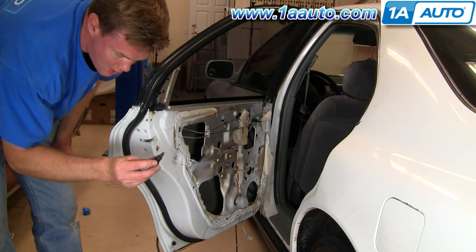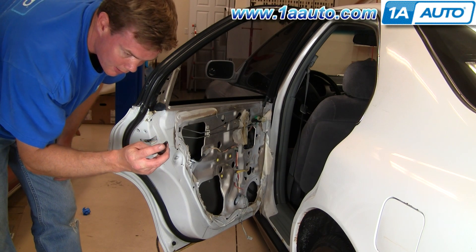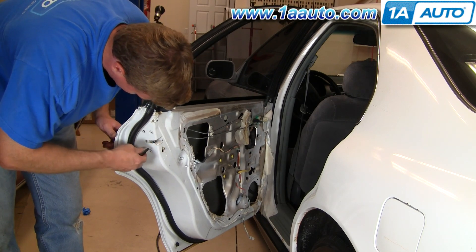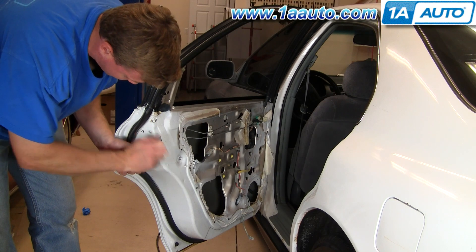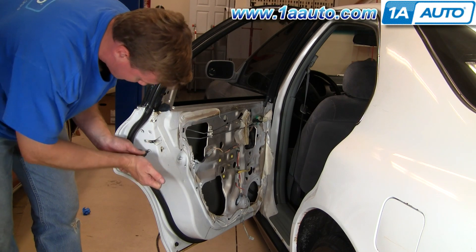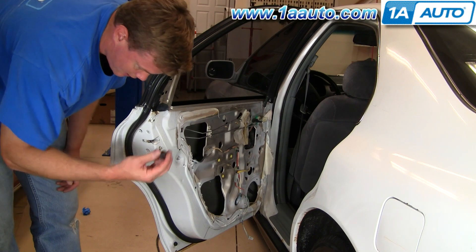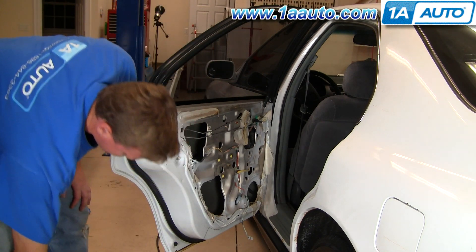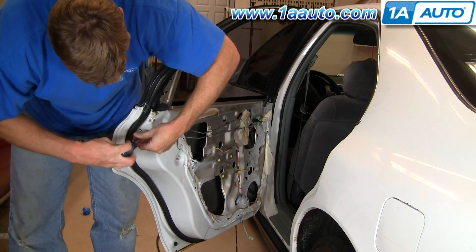But more likely, you can get a bit with a large Phillips head and put that in and get them off, because with this you would actually use a ratchet driver and you have more leverage. You push it in and it only costs maybe two or three bucks at the most. Luckily, on this car it's okay, so I can remove these screws.